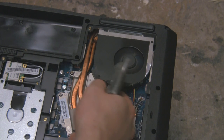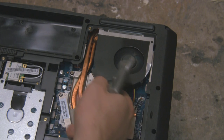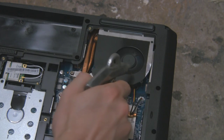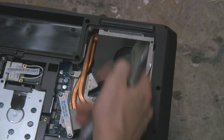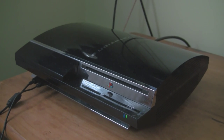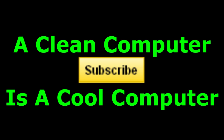And all you've got to do is the same again — flow air all around it, check the RAM, check the hard drives, check everywhere. Just get the dust out. You'll find this really improves the cooling of your computer, whether it be a laptop or a desktop. You can even do this for your games consoles — your PS3 or your 360 — you don't even have to take the case off, you can just blow it through the vents and watch all the dust fly out the other end. Thanks for watching and don't forget to subscribe.